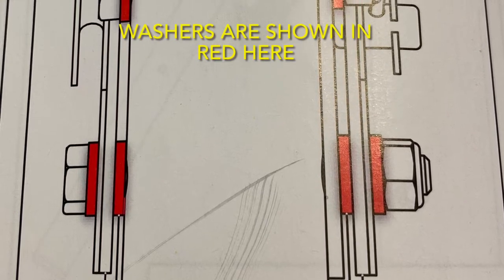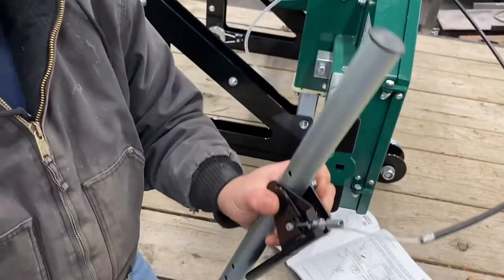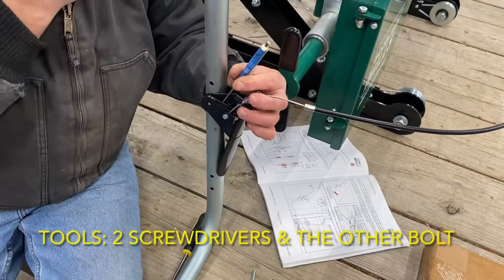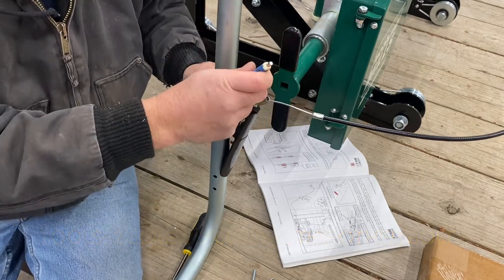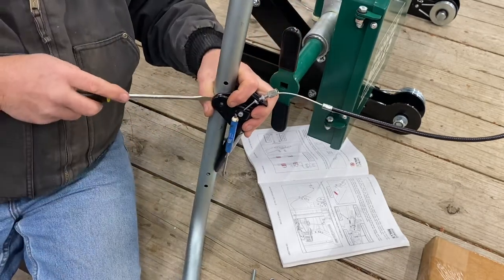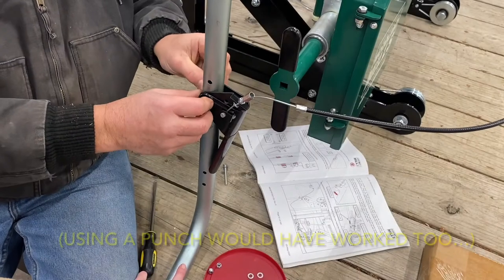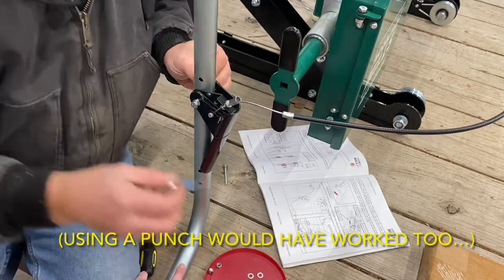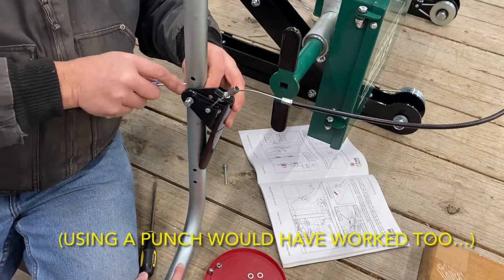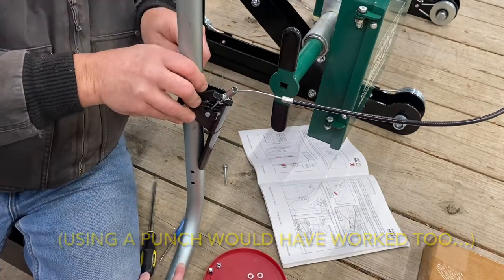The lower bolt and four washers were placed first. It was a tight fit and tricky to maneuver all four lower washers into place. We used two screwdrivers — one regular flathead and one smaller magnetic flathead — to help maneuver the washers. After several attempts, we found that using the other bolt helped hold two of the washers in alignment as the bottom bolt was inserted from the other side. This part took a bit of patience and was a tedious process. Using the shorter bolt to keep the washers aligned while inserting the longer bolt really made this part easier.